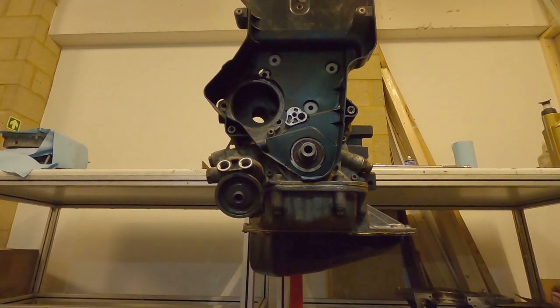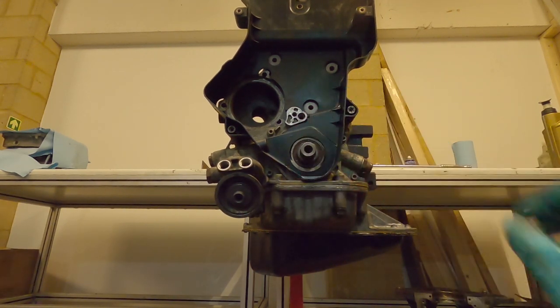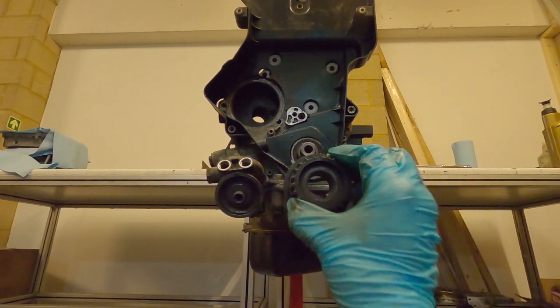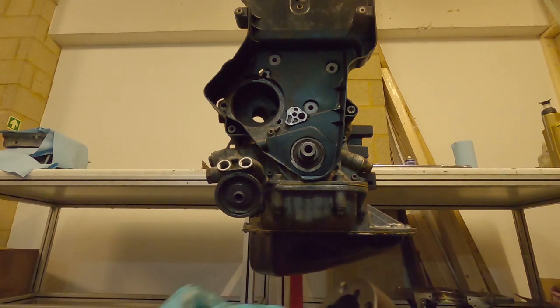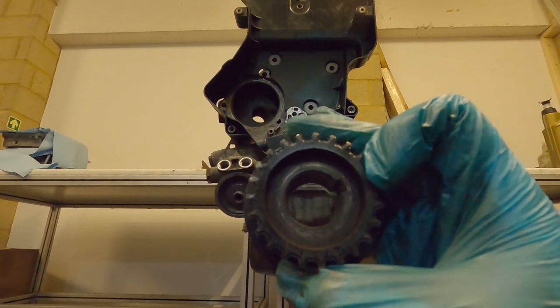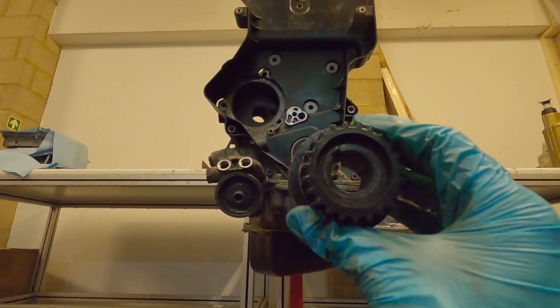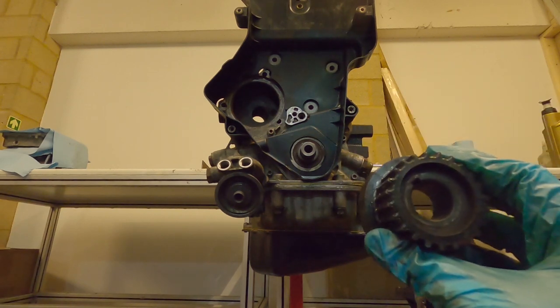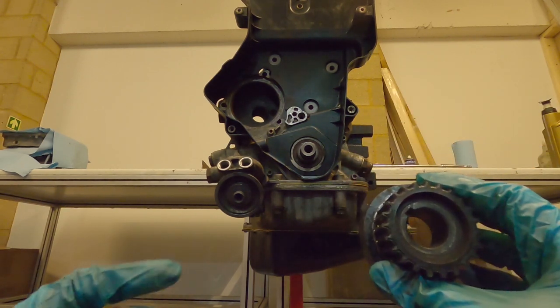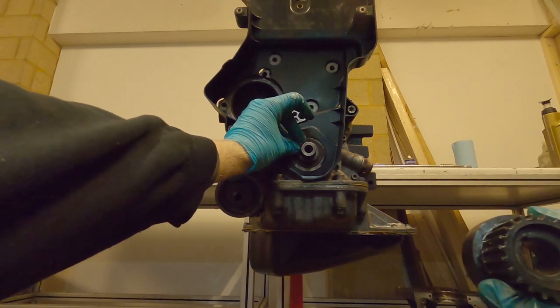There are several components to the crank pulley. Before you put your crank pulley on, there's a ring that has to go on the crank first — if you don't do that, your pulley will be too close to the engine and will rub. Most importantly, there's your woodruff key — this tiny little piece of metal goes into a little slot and stops the pulley from moving out of alignment with the crank, so that your pulley's zero degrees matches your crank's zero degrees. There's a known problem with these engines where the woodruff keys wear. If you insert your woodruff key and it doesn't sit there tight, or you can wiggle it from side to side, your crank slot is worn.